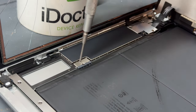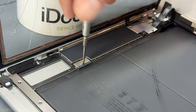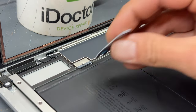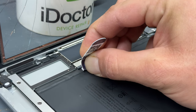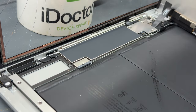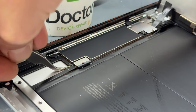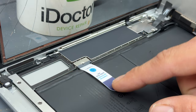It's very important to isolate power from the device before we start removing anything. Unscrew the screw here, and then using that little battery isolating pick, insert it underneath the battery terminal to isolate power. You might find that it doesn't go in straight away — if that's the case, the easiest way is to use curved tweezers to slightly lift the board, releasing it so you can insert the pick just under the battery.